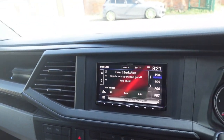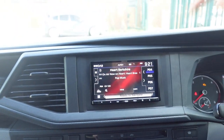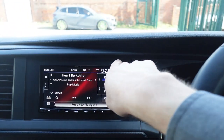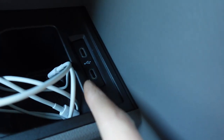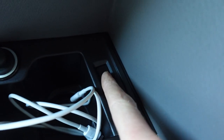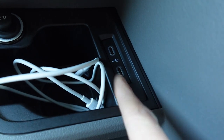So the customer in this one has gone for a Kenwood DNX9190. We've used the bespoke Kenwood fitting kit, meaning everything VW still works. You've got the fascia which allows the Kenwood 7-inch screen to fit. The factory USB-C connections down the bottom are still working — number one goes to the Kenwood for Apple CarPlay and Android Auto wired, and number two becomes a charging port. Seamless integration.